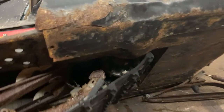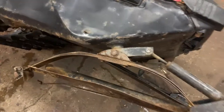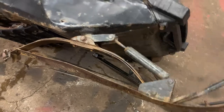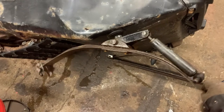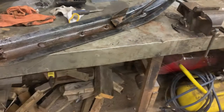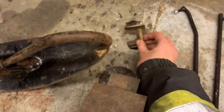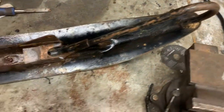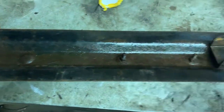She's not too bad, just a bit rusty looking. First thing I'm going to do is the easiest job — this ski, as you can see, has seen better days. Let's pop this off and get a new ski on with a new carbide. Not too bad so far — this back bolt is stripped so I might have to cut it off, but it's pretty easy to get the ski off anyways. It's only this one side I've got to replace — you can see where she broke off right here, three bolts, that's it. I noticed I had one bolt that was stripped and one that actually split in half — I had to cut one off and the other one broke when I went to unbolt it.